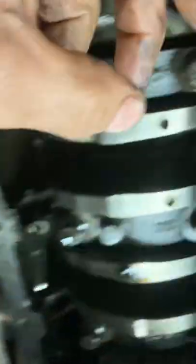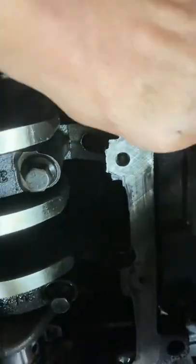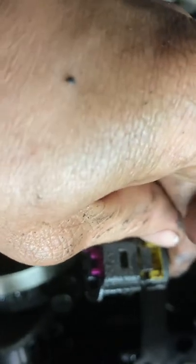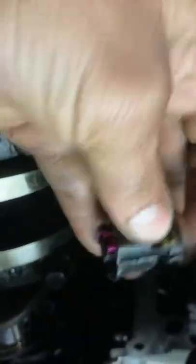There are two tricky bolts — these two here that need to come out, which is just off the bottom of the DPF. You don't need to take the DPF off. One 10mm bolt to take that out — this wire here. What you do with this is you have to raise that yellow thing right up to then push that in to get that off.